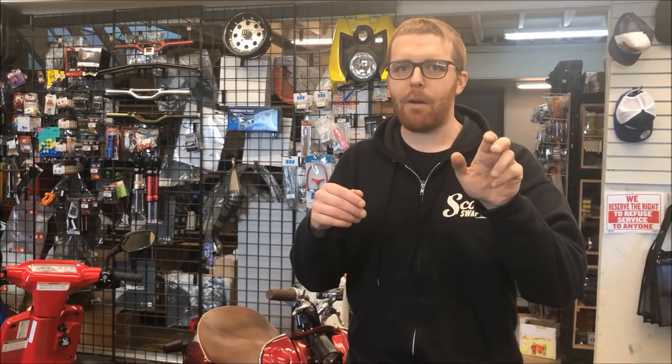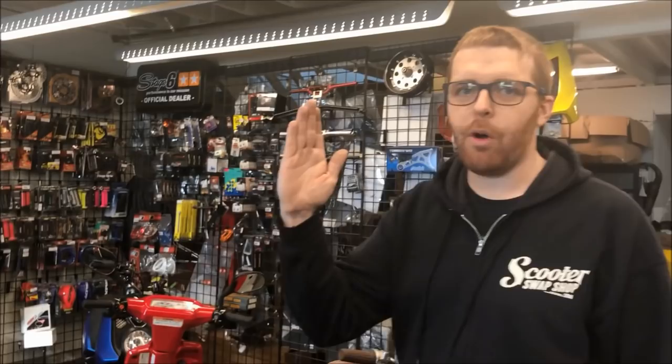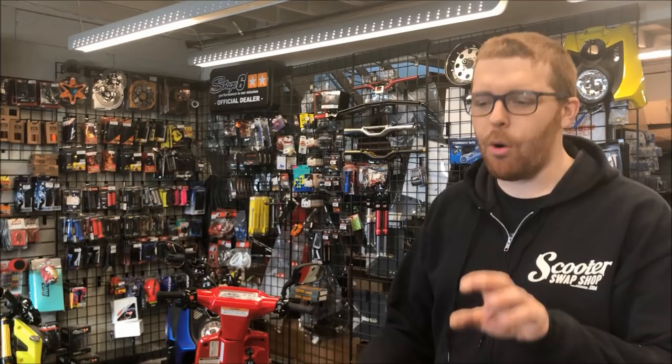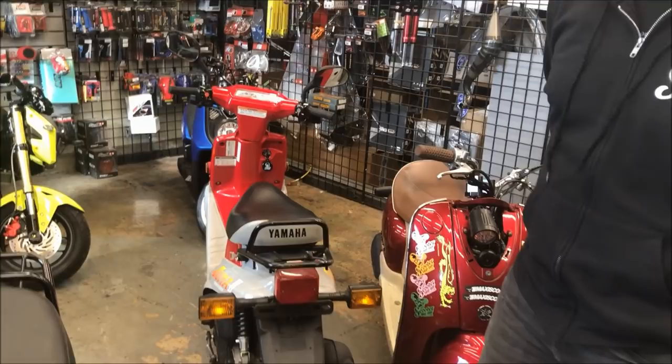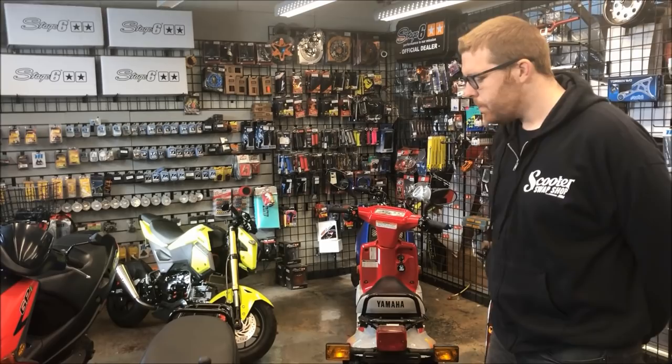And doing wheelies, you want to rely on just basically being able to tap that rear brake and get it to come back down or get it to stop from going back. And that's so you can get on that kind of 12 o'clock balance point, is having really, you want to trust your brakes. You don't want to have sketchy brakes that don't always hit when you just barely tap them. Well, yeah, you can see how these snap back. So you know exactly where your brakes are grabbing. If you have squishy old cables, replace them, because you're never going to feel that confident with your brakes. You need to know right where your brakes are going to grab, right where they engage and everything.